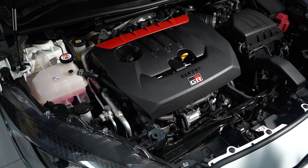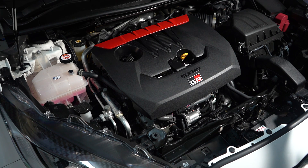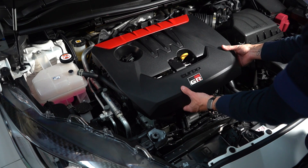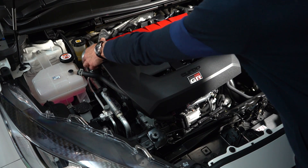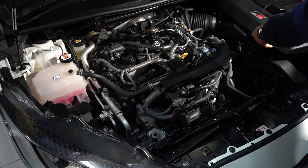For your information, this is a right-hand drive GR Yaris. A lot of the process will be identical, but I'll go through how it's done on this car. First thing: take off the engine cover. If you haven't done it before, it is literally just some rubber fittings on ball fittings. Take that off and put it to the side for now.